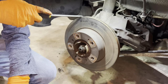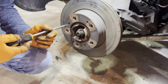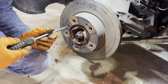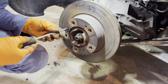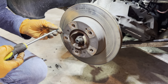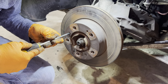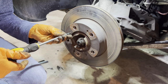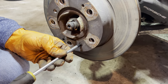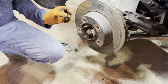The brake rotor is held onto the hub just by two screws. These screws can be your nightmare, especially in a car like mine where maintenance hasn't been kept on top of — they can rust in and you might need penetrating fluid. I'm pushing in as I rotate because if I strip the screw heads I'll have to drill it out, which would be an absolute nightmare. But they both came out quite easily — thank you car.